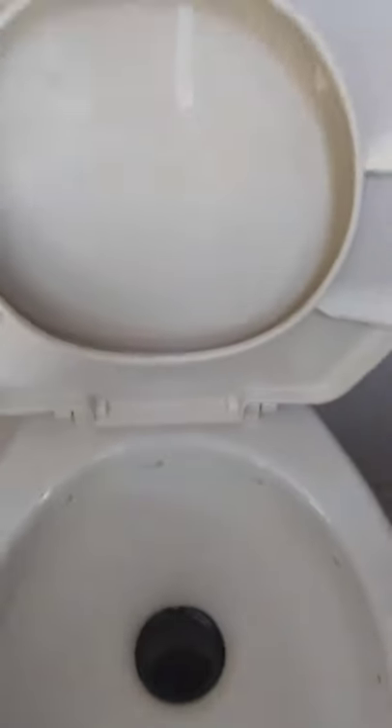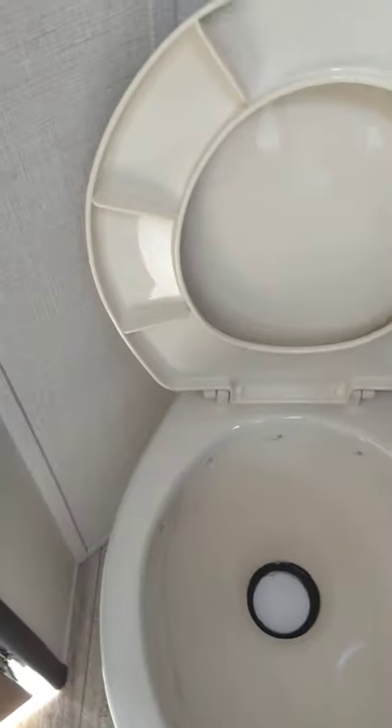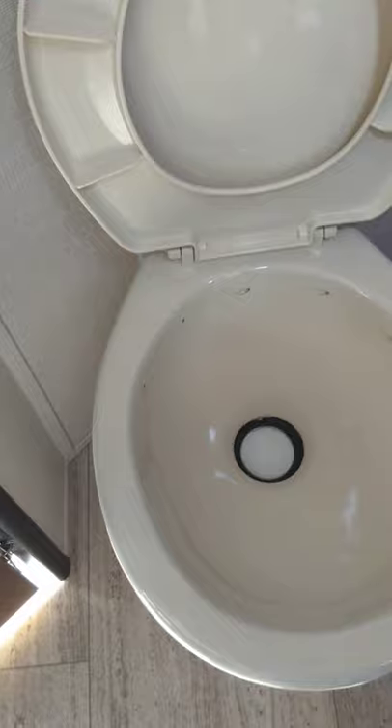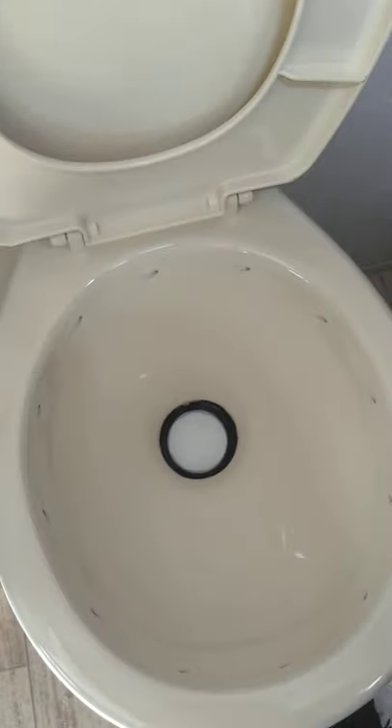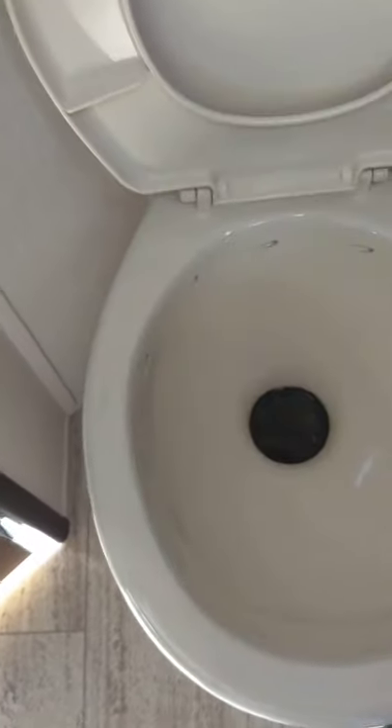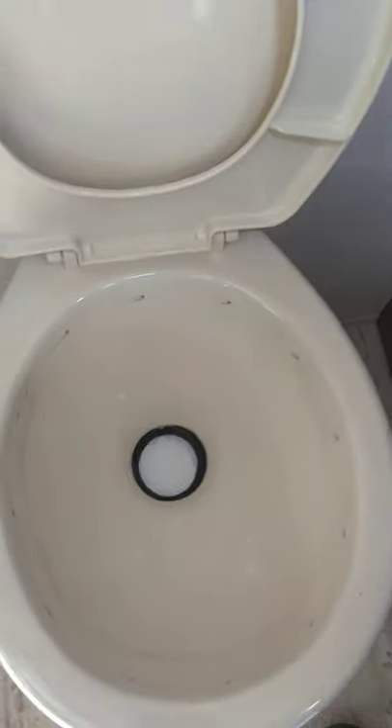The thing about the toilet you have to remember: flushing with this pedal opens the trap, and the black tank is directly below. You can't operate this without water or chemical in it. So when you first get to the campground, you're going to plug it in to power and hook up your hose. Then come in here, put a dose of chemical right in there, step on the pedal, water will come swirling out, and put about a gallon or so into the black tank. Anytime you're starting off with an empty black tank, you have to put chemical and water in there.